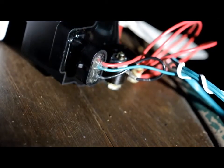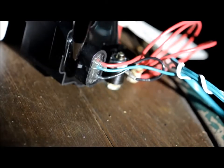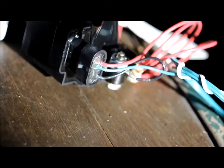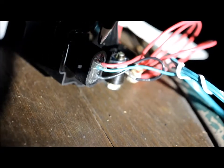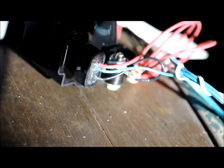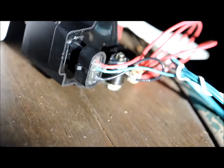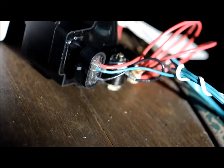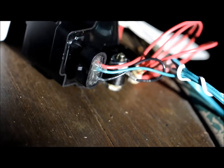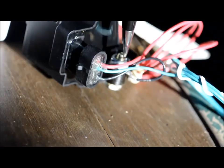On the ignition module, or ignition coil, there's a little knob on the side for the connector latch. The red wire is at the top and connects to the battery. The green wire is the second one down — that's the trigger coil input. The black and brown wires pick up the ground connections, which just go off to the mounting bolt here.